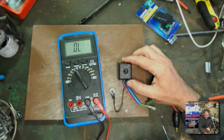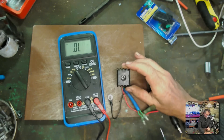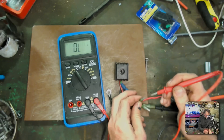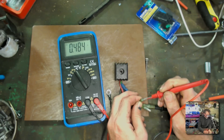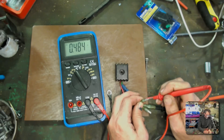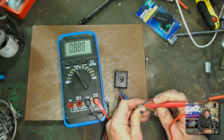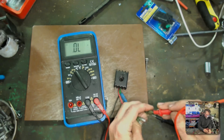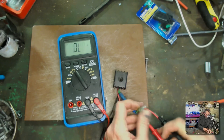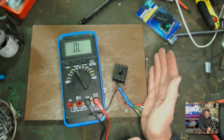This one is from a smaller outboard — it's only got two green wires, so it's a single-phase I believe. Now we do the same thing: put our black wire into the red, then test the two greens. Here we get slightly lower voltage drops — around half a volt for both — which is in the ballpark. Now if we swap, put the red into the red and look the other way, we've got open circuit and open circuit. So this is a good regulated rectifier, and the other one is bad. We want about half a volt drop in one direction and no continuity in the other direction.